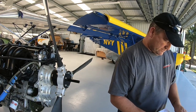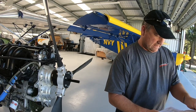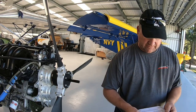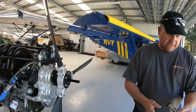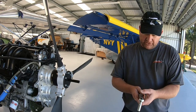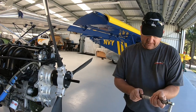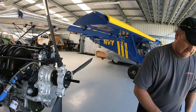At page 5, it has our torque specifications. So for the quarter inch clamping bolts it is 10 foot pounds or 13.56 newton meters, which is what I am working on, newton meters. Double check that that's 13.56. Put the locker on.